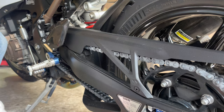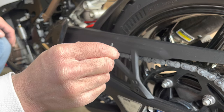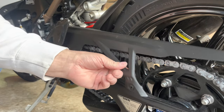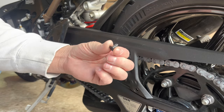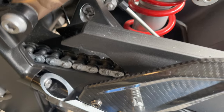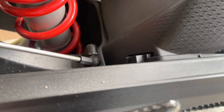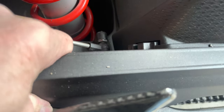It's actually threaded so you don't want to strip these out — you're going to have to buy new ones. This thing just pops right out. There is a rivet piece in here; this will go on your new piece and will screw into there to reinstall it. Now I'm going to get the T25. I got the bolt out of there — it actually dropped right there — but to release this from your stock one you're just going to pull this forward and then it should come right out.